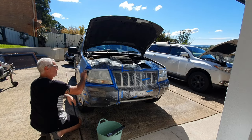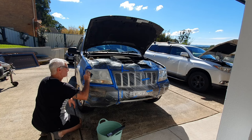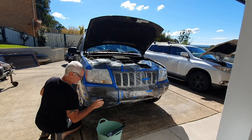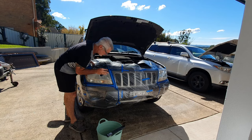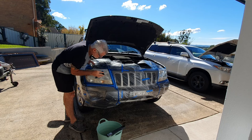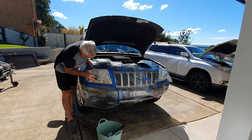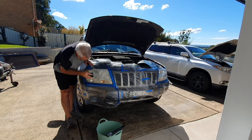Follow the radius around the side of your headlight. If it's not flat, once I've finished doing it flat I'll just go around in lots of small little circles to take the long scratches out. The headlight can look really bad right now, but as I go through the grades you'll see it become crystal clear.